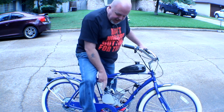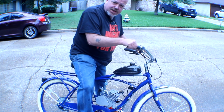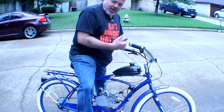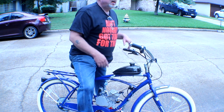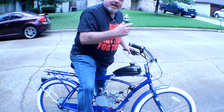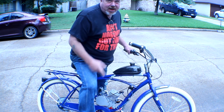With this bike I only have the coaster brake, but there's an additional braking method — your kill switch. If you're cruising with the clutch out and want to slow down, hit the kill switch. Engine braking from the motor's compression will give you additional braking on top of the coaster brake. Then, just before you come to a complete stop, if you want to keep the motor going, release the kill switch to restart the motor, pull the clutch in, and you'll still have the motor running. Be careful and watch out for cars because they're not watching for you.